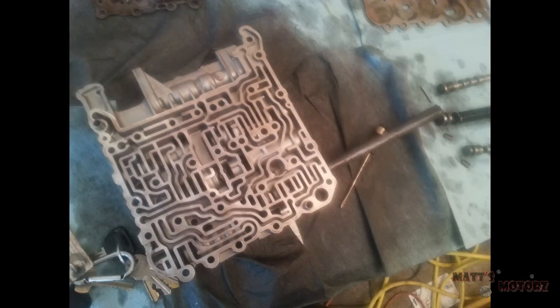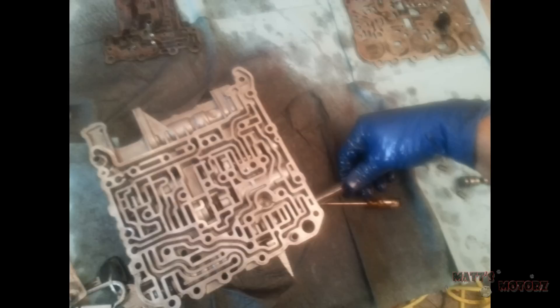You don't really want to go any lower than 800 grit. What you do is wrap it into a tight roll, put it all the way down into the bore, let the roll expand so it's touching the walls, then spin the roll back and forth. This is how you polish the bore out. Keep doing this until the valve falls under its own weight in both directions.